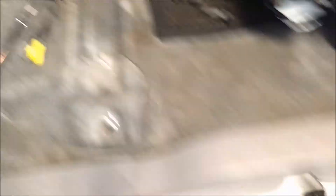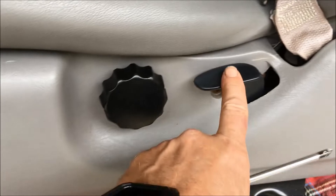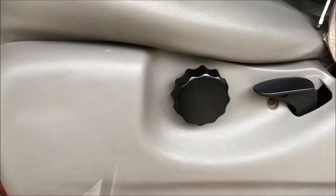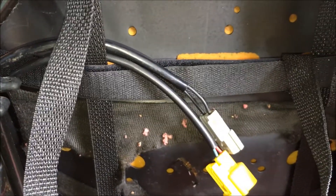After that, to get to the seat cushion you'll need to remove this cover panel. This just pops off and you'll need to unscrew this part here — there's a screw underneath and multiple screws on this cover panel that need to come out in order to access the cushion more easily. The easiest way to remove this cushion is by taking these four pan bolts. The whole pan will then remove from the seat, making it much easier to access.